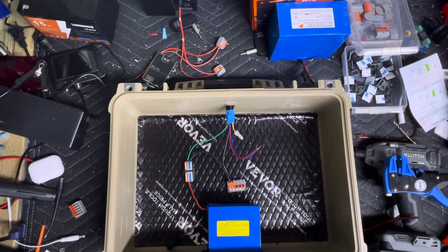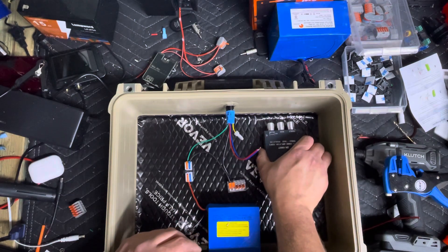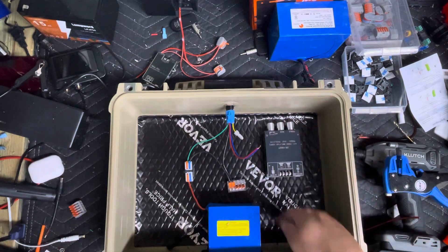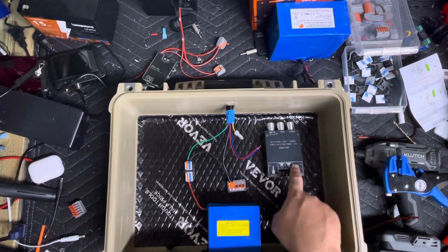If you made it this far, go ahead and comment below: 'Make sure you get a new razor blade.' Now, we've got to make sure that we place it a little bit higher than middle. That way it's not too high where we can't get to these switches, and it's not too low where we have no room to run the wires — because we've got to get the speaker wires here and the power wire here.